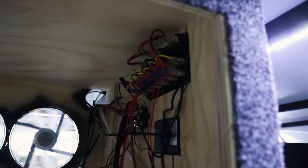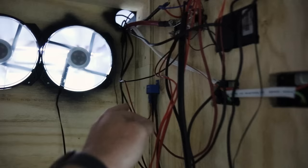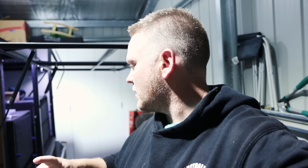We've got a negative bus bar in here, so all of my negatives can run to that. And then the negative wire basically runs back into the battery out to there. So it's super simple. Relay to run the travel buddy, that's all there. I've mounted it all in there because I was trying to keep everything out of sight, out of mind. And it's super, super quick and easy to get the fridge out, which is like 5 screws and we're done, it's easy. On the other side, not going to show you the batteries just yet.